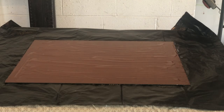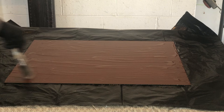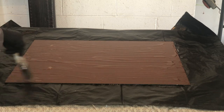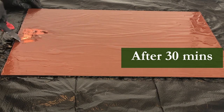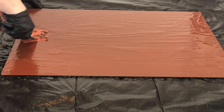Step two is to spread the paint stripper on the back of the mirror — this is a very important step. The factory paint on the back of your mirror is very tough, so you have to spread the paint stripper very evenly and don't miss any spot. Before scraping the paint off, you should try it first. It took about 30 minutes for my paint to get ready.